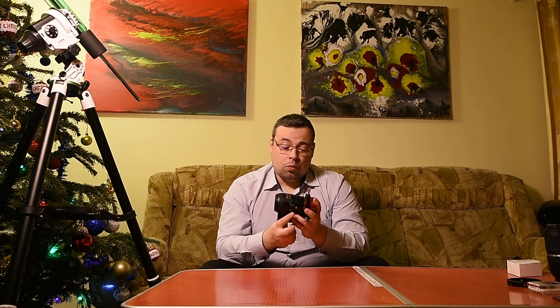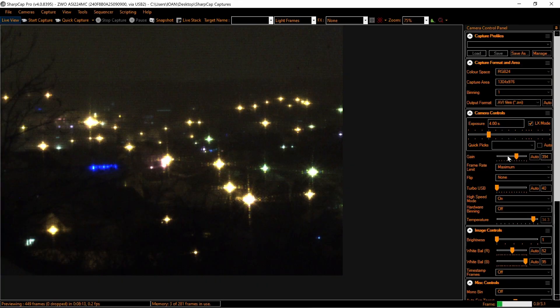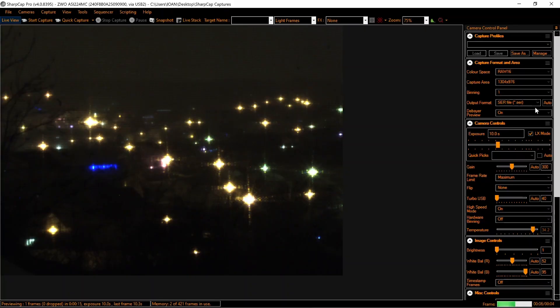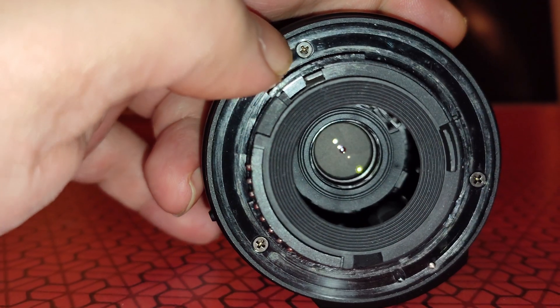When I first tested this adapter with the 40mm lens and the ZWO camera, I did not know that the aperture would be closed. It was cloudy outside so I just made the test through the window and filmed the town. Playing with the exposure settings, I noticed the image was much darker. I should have been at f2.8, but I needed like 5 to 8 seconds to see anything — a longer exposure time than I usually needed even with a DSLR camera. I checked the aperture inside the lens and it was actually closed, at a high f-number. You won't be able to image with the aperture wide open. This is a big problem.